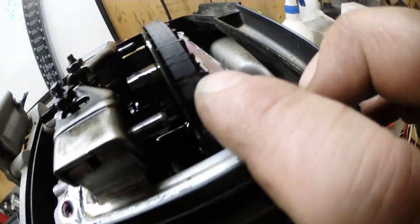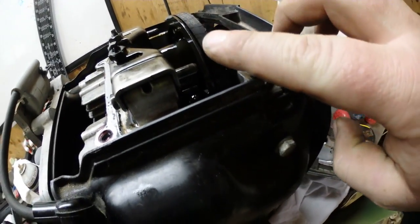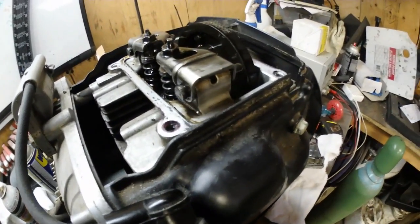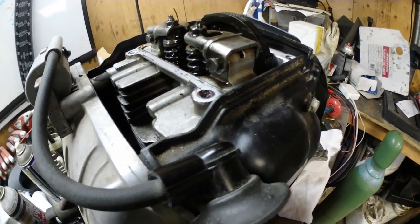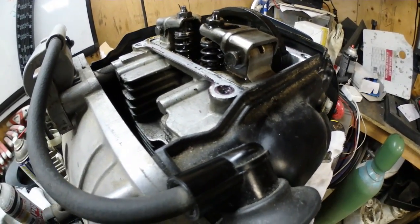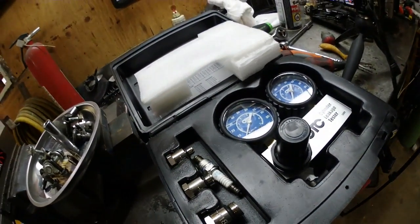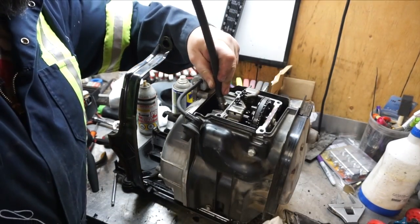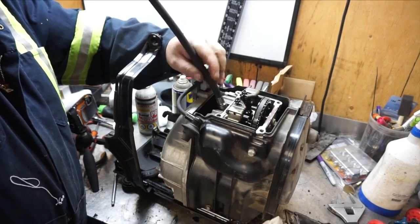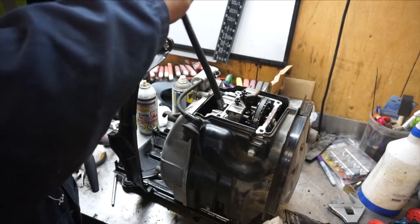This is one of the main reasons why we're doing the rebuild. The timing belt is all cracked, and since we're going this far we might as well price out a set of rings and probably some valve seals too. Looks like an M10 thread so we could be in business. Let's get the leak down tester hose installed — hopefully it is a 10 millimeter, and it sure is.